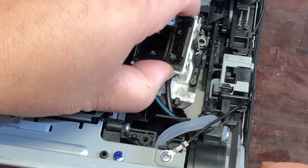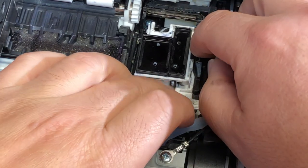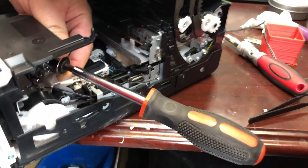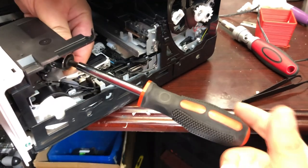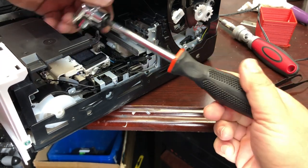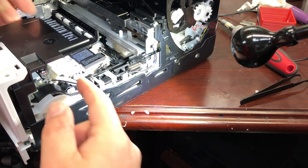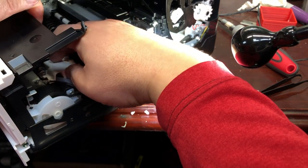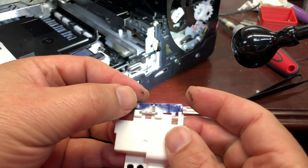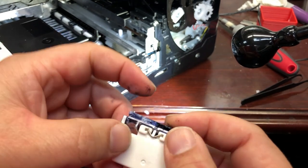The problem is the tab is in exactly the same position as the forklift. So if you put the tab in, the forklift will not pick up the lever — this won't work because the lever is still underneath the forklift. As for how to take the cover off, that's covered in the previous video, I won't repeat it here. I use an angled screwdriver to remove that little white piece to give me more space. You can just bend the cover over and use a regular screwdriver. It's easy to remove and goes back just as easily — just slide it in like this.